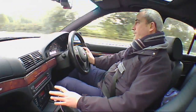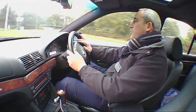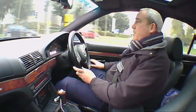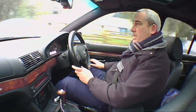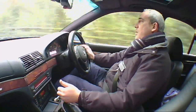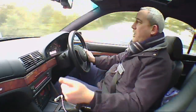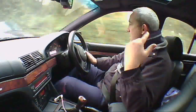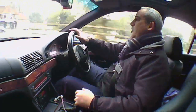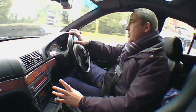One good thing about these cars is when you stick it in reverse, the near-side mirror will drop down so you can see the curb. You can switch that system off by flicking the wing mirror switch to the right — that does cancel it. It's a very useful feature, but it can backfire because sometimes the mirror will come down when you don't need it to and you won't see people walking behind you. I would recommend disabling it unless you need to use it when parking.